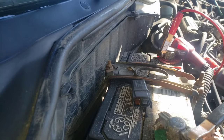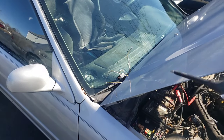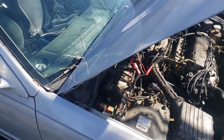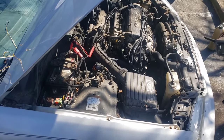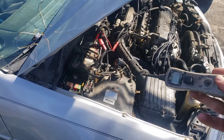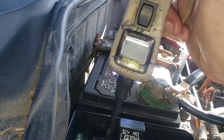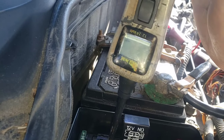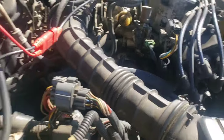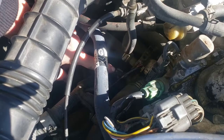Let's say your relay tests good. Next, check for the signal. For this car, I turned it on and got it hot because the customer complaint is that it overheats at a stoplight, but as soon as you get going it's fine — that's often a cooling fan issue. I got the car to overheat, then came back and used the probe to look for the signal from this relay connector to turn green, indicating a ground.